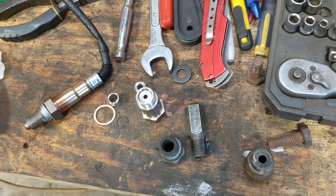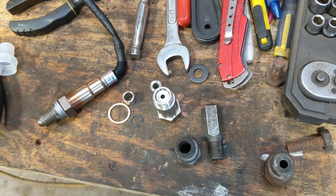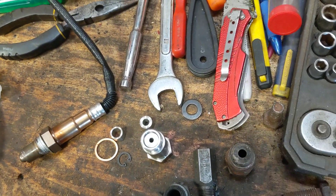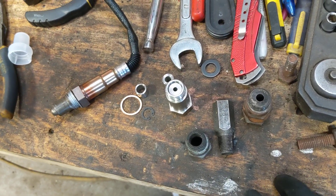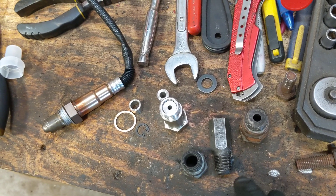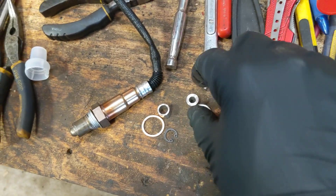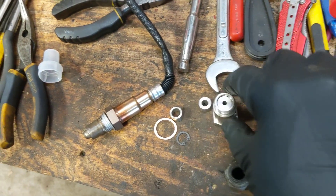These things cost a couple bucks, they're not very expensive, and it saves you from buying a whole new catalytic converter or paying a shop to do it, which can be very expensive. For those who say it's because there are pollutants or something's wrong — I've bought brand new catalytic converters, put them on vehicles, and they would throw a catalytic under efficiency code, and I've had to use these to fix the problem. So they work.